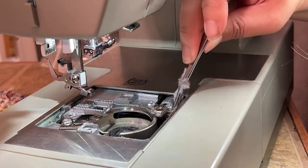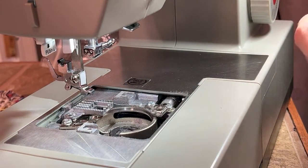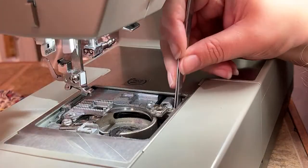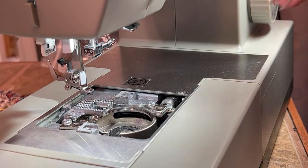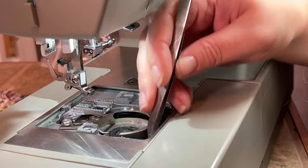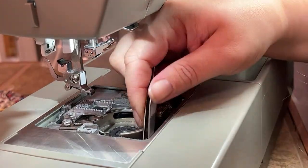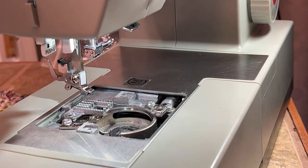A lot of times, modern machines, they tell you that you don't need to oil it because it should come with enough oil to last a lifetime. Well, let me tell you, not if you sew as much as I do. I do oil my machine, and I have a video on that on my channel if you want to see it, but I might do that today as well. I check the oil on it. But all of this thread buildup acts like a sponge, and it's taking the oil away from the parts of the machine that truly need it.